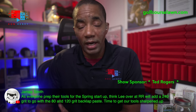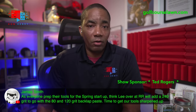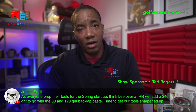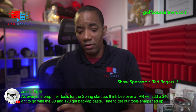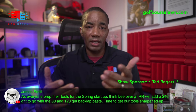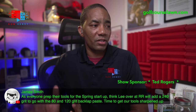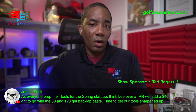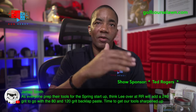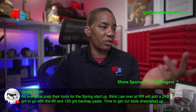Yeah, guys, that's a good point. This time of year, while you're waiting for the lawn to start growing to where you can get out there and start having fun mowing it, take this time to get all your gear sharpened up. If you've got mowers, get them sharpened. If you've got string trimmers or anything like that that are gas powered, do your maintenance, change the spark plug, put a fresh air filter on it. Just do all the things to put yourself in a good spot so that once the grass is really going, you are good to go. You're not going to be like everybody else, struggling to get a spot in the workshop to get your equipment taken care of. So that's good advice, James.